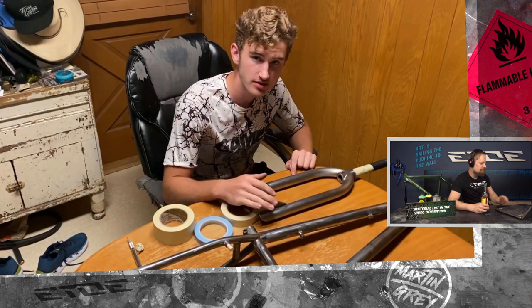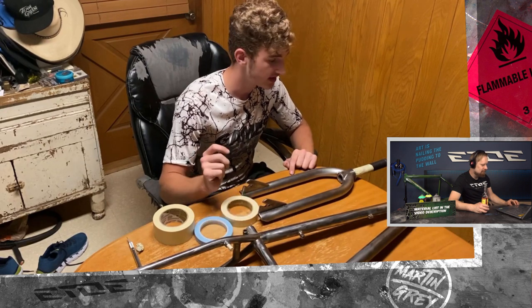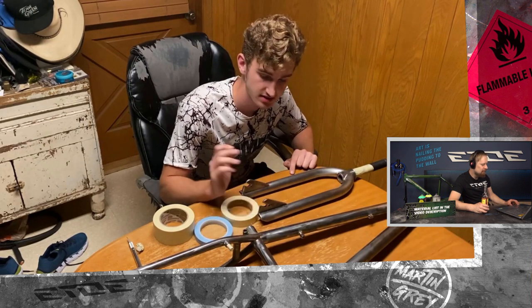So I've already stripped all the paint on this bike, sanded it, and now I'm in the middle of masking. It looks not so bad — it's completely stripped. I recommend media blasting if you want to go fast. Paint strippers are bad chemicals and you have to dispose of them properly. A better, more economical way is media blasting — and if you do media blasting you also get a perfect surface with no need for extra sanding. The frame is well prepared for the next layers of primer and paint.